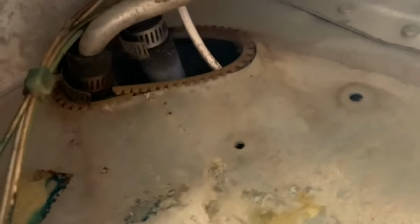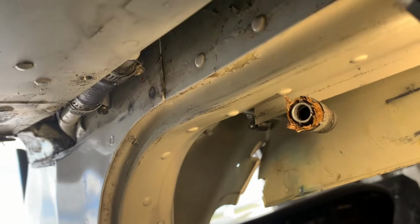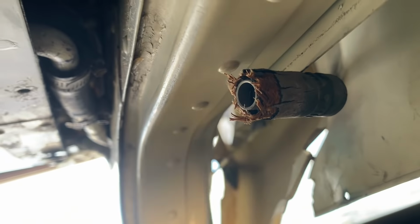Here, so we're gonna check that out while we're in here. Well, it took me a minute, but right there, that's coming out of the gas tank going to the wing. It's one of the crossover tubes, and it looks disgusting. Goodbye, flashlight. But we have evidence of fuel come out of there. It's out of that hose clamp to your left hand of your screen there. So we're gonna have to replace that, and it's gonna stink. Got a little bit of blue on my hands, and I'd say that hose right there needs to be replaced. What do you guys think about that?